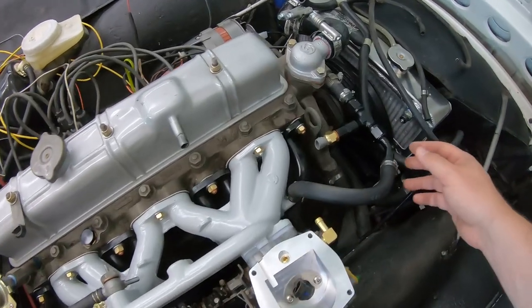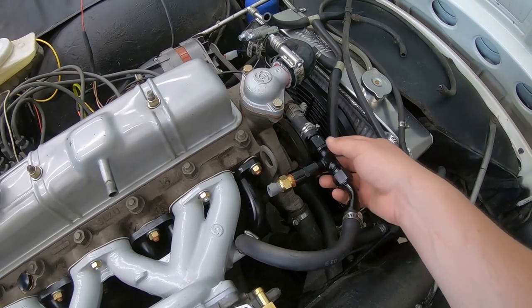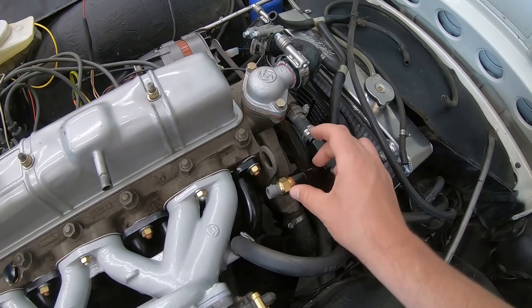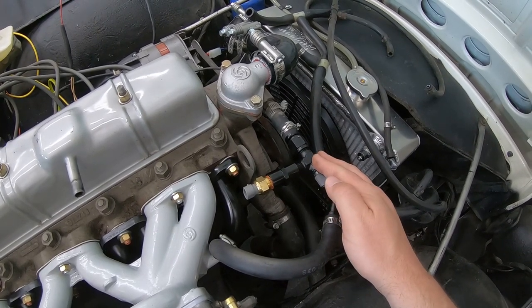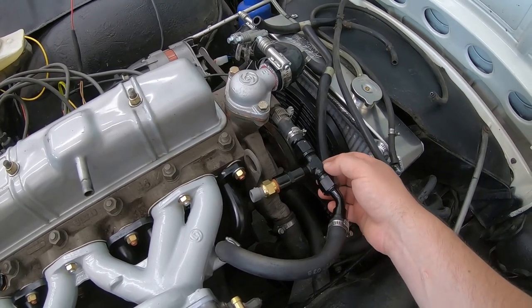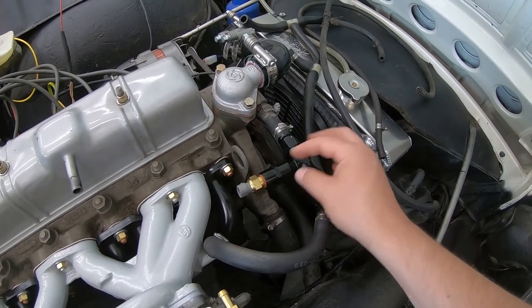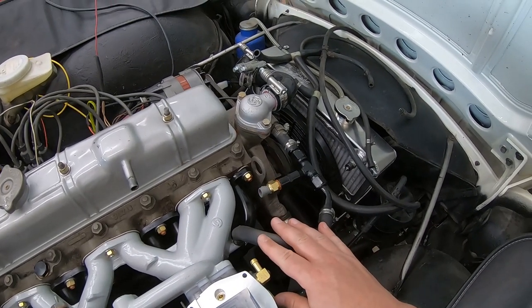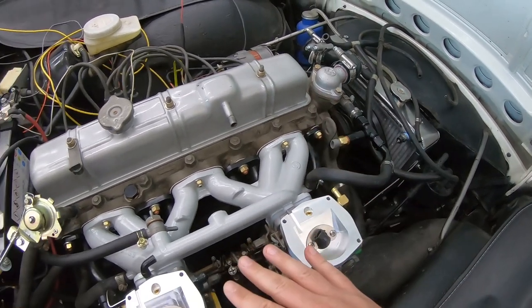You can see the solution I came up with for the coolant temperature sensor right here. I cut the existing hose, added in two 8AN adapters with an 8AN T-fitting to NPT fitting, and I had to stick this adapter in here to get to the sensor. Hopefully having the sensor removed from the coolant flow path this much won't cause too much of a problem. But if it does, I'll just have to get a T-fitting machined that moves the NPT female directly into the flow. Really, since this is just controlling enrichment, it probably won't matter all that much. Now that this is buttoned up, I can go ahead and test for coolant filling and leaks, then move on to fuel and vacuum.